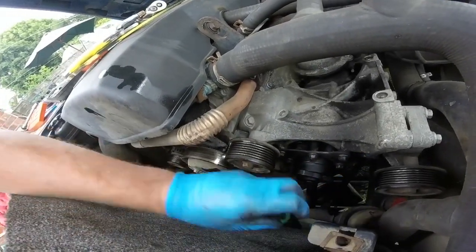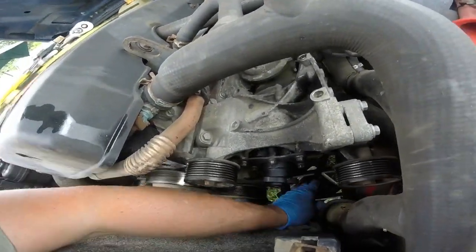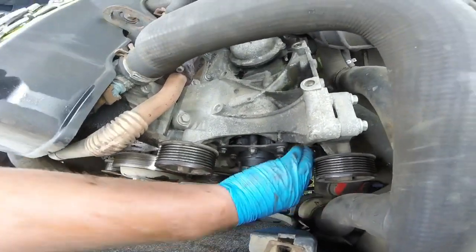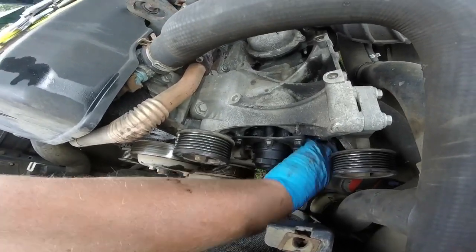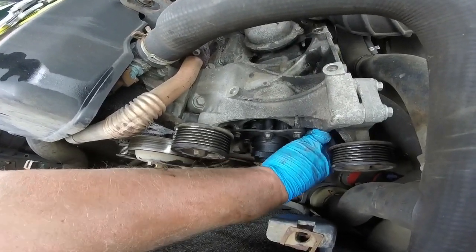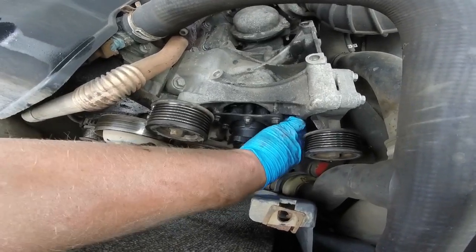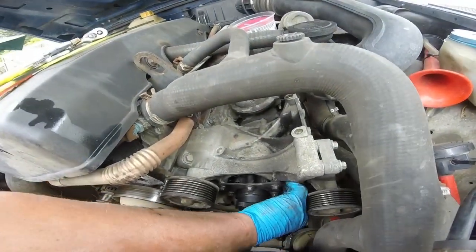So I've taken that little bung out that was in the side, so that means now I can get that pipe back in, if you can see, and then get that connector back here, I think it started. Feels like it has. Usually sometimes a bit of a pain, like the brake pipe end connector things. But sorry, my hand's in the way, you can't see, but that's gone on there easier than I imagined it would. So I'll just nip it up with a spanner.